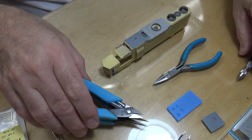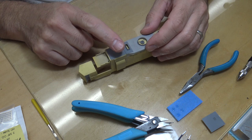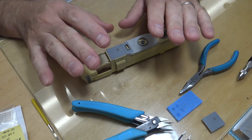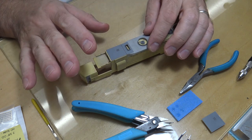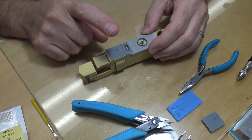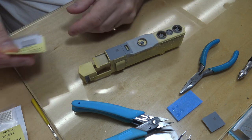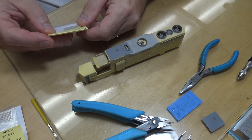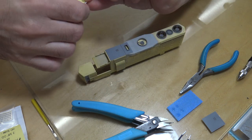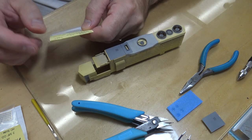So let's go over the lift rings real quick. For the smallest size on the second gen units, this is the same for all, from the GP30 on up through the dash 2 series. On the inertial filter and the exhaust hatch, you have the smaller size, which is the Plano number 14653. These are 2 3/8 by 1 3/8. So 2 3/8 OD by 1 3/8 ID.